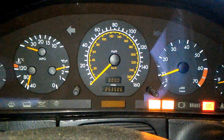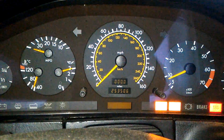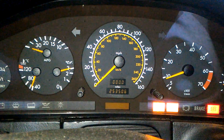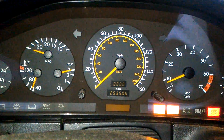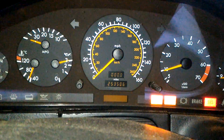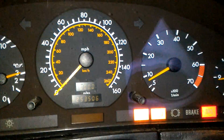Here's our idle speed — as you can see it fluctuates, it's not steady. It's doing it by itself because the throttle body is not controlling the amount of air coming in, and therefore the needle is not steady. The RPMs are fluctuating on their own — I'm not pressing on the gas pedal at all, as you can see my foot is off the gas pedal.